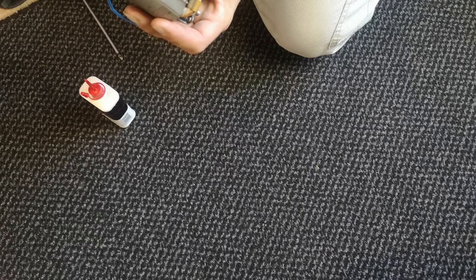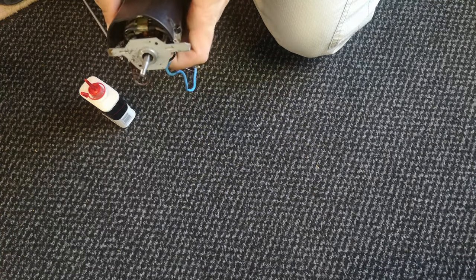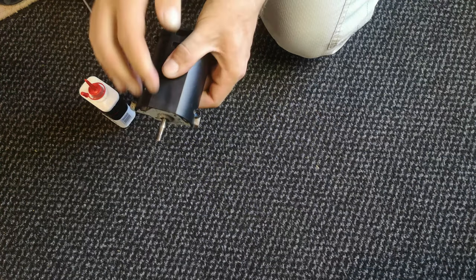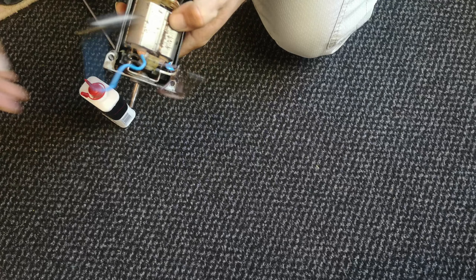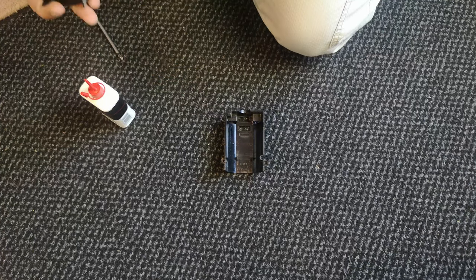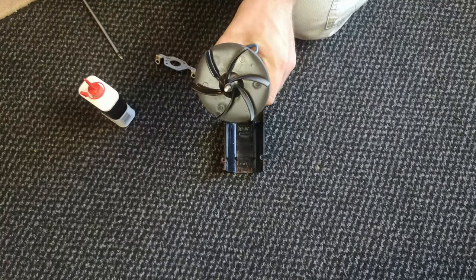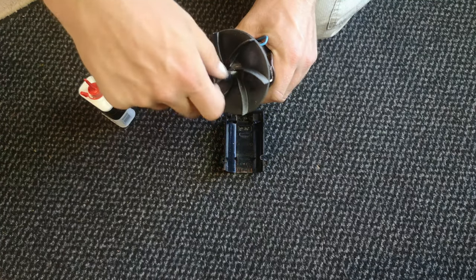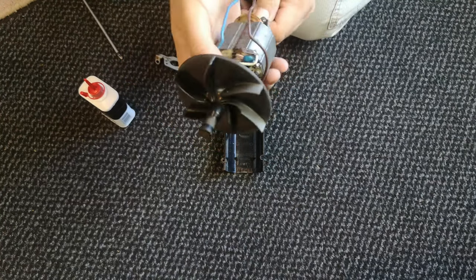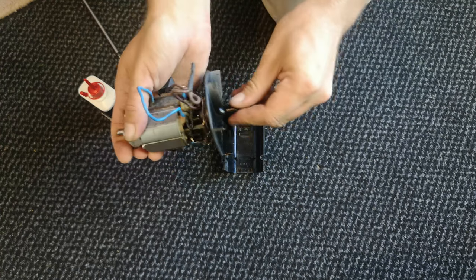Right - carbon brushes. We need to put this part back on, then these bits back on, so that lines up there with the screw holes. Actually, before we do that we'll put the fan on because then we can tweak it down while we still can. That should be as simple as putting the spacer piece on, popping the fan on, then getting the belt spindle and screwing that on counter-clockwise. Give it a good tweak down - that's all it should need because it tightens itself down as the machine runs.